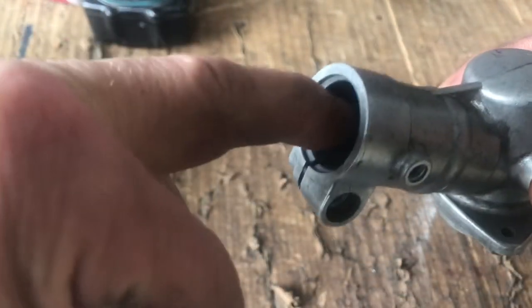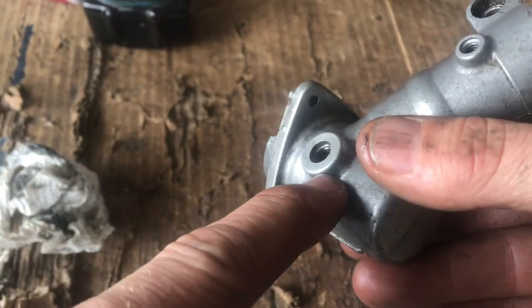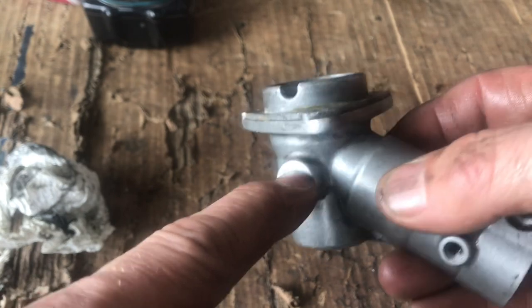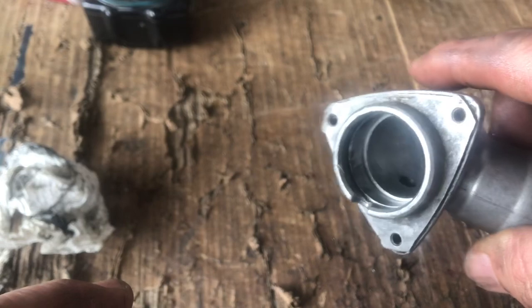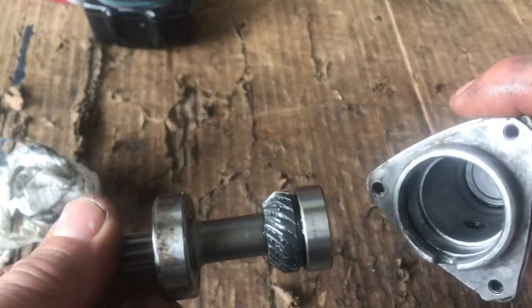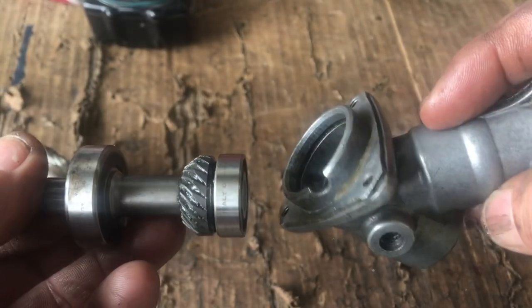You just need to know the size of the shaft — it'll fit any shaft you want. So what I'm going to do now is I might replace that bearing, and I've cleaned that up. Now this bolt was missing and I can see the threads are a bit knackered. So I've cleaned this all right up and I'm going to re-thread that and find a bolt that goes in there. That's just like a service hole to put grease in there. That's why I've got to take all the grease out of here, because I don't want any little bits of filings in there which will get in these bearings.